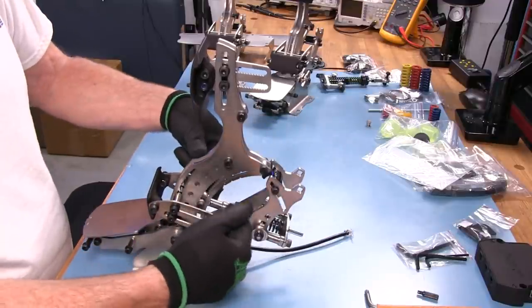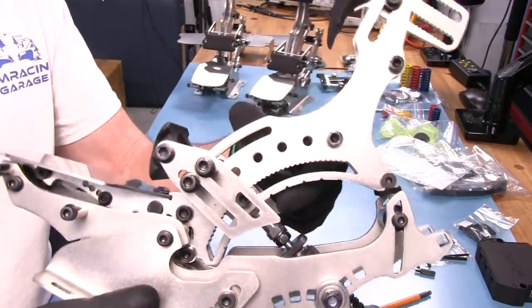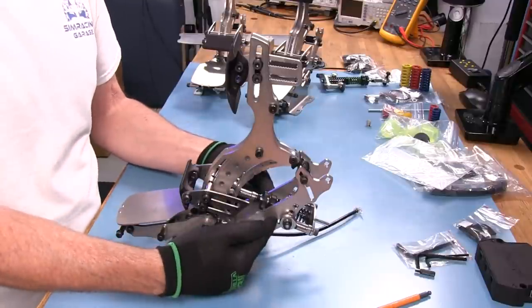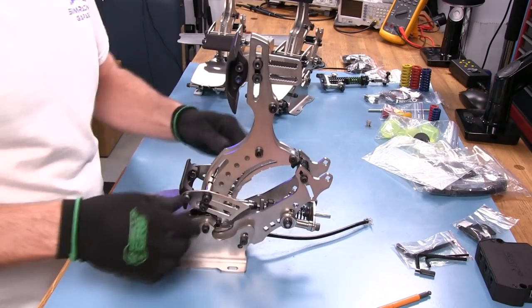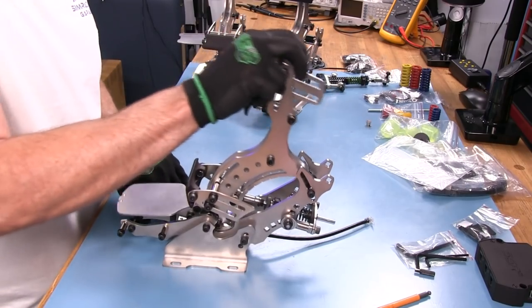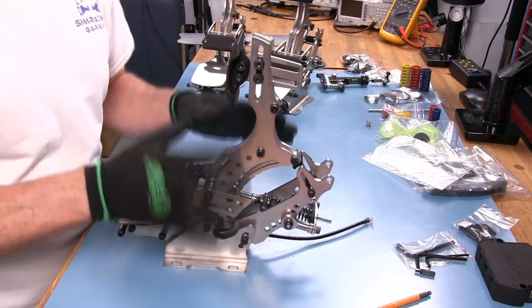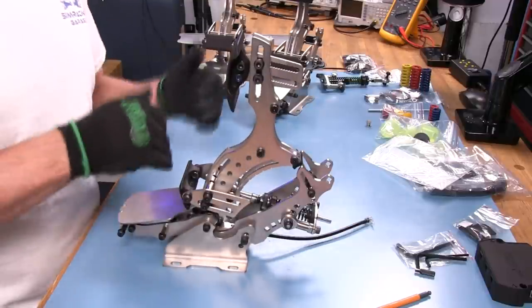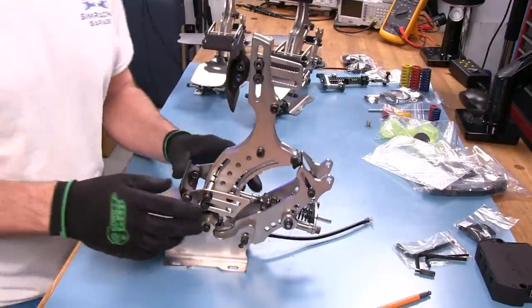We also have the adjustment for this piece here, which is the rod end that goes into the big curve with the teeth in it. And we can adjust that as far as leverage on the spring assembly. When it's further down like this, we have more leverage on it, so I could push this down. And it stays where it is too, by the way, being that loose, so it's pretty easy to get an adjustment and then start working it. It won't ever move. Now, if you get it to exactly where you want it, you may want to cinch it down tight again, depending on how hard you are on a throttle pedal. If you're doing heel and toe and smacking it around, you might want to do that. I don't know.